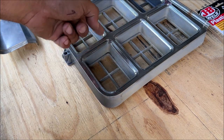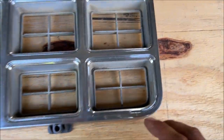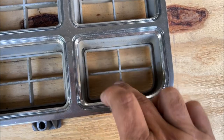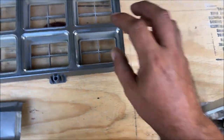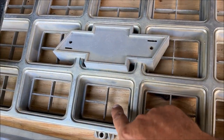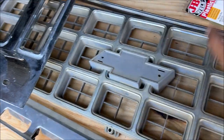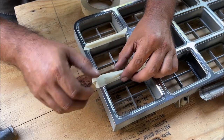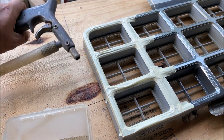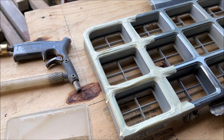They went back and masked it off somehow, then painted the entire square inside and the entire edge. We're going to duplicate that. Be super careful when you clean these with a brush — you might knock these things out with a pressure washer. It's very difficult to clean, so we're going to lightly sandblast them. We have two knocked out and we're going to fix them in this video with pieces from a donor grill. We have it masked off and will just use less pressure.